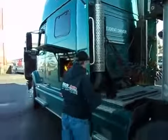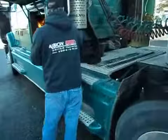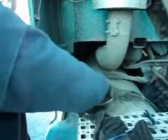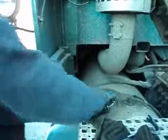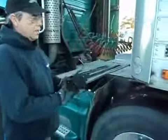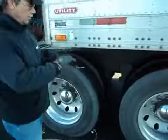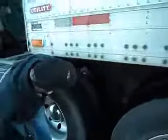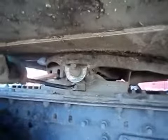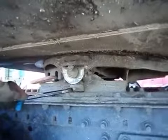The only thing left is to open up the fuel tank. Same fuel on this side as the other side, so my crossover is working. Both tanks should drain the same, and I'll check the gauge inside the truck to make sure it says quarter tank. Working back here — my mud flap is secure. Next thing are tires, but first I'm going to talk about the fifth wheel. This is called the fifth wheel. Right here is a locking pin — I can slide the fifth wheel along these teeth, move it forward and back. This is the pin that locks it. My fifth wheel pin is in and locked.